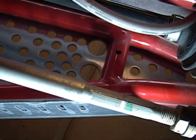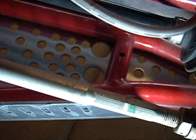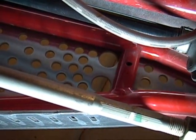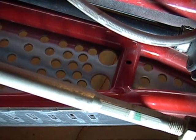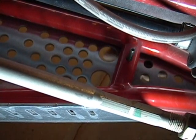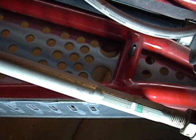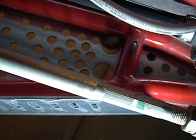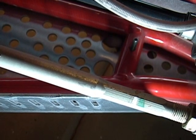I've got the other two bolts with the clamps installed on the inside of the A-arms. Now we've moved to the outer side of the A-arm at this cross member right here. As you can see, that hole goes all the way through. So what we're going to do is take the long bolt going from the bottom up and mount it right through that hole. Then we'll take our washer and lock nut and put those on there. Now that everything's installed, we'll get everything tightened up, remove the plastic on this side, repeat the process on the other side, and we'll have our A-arm guards installed.